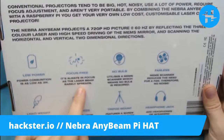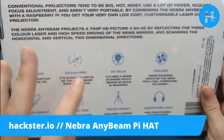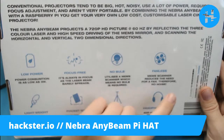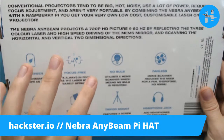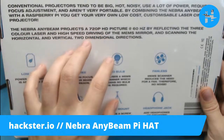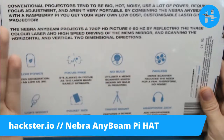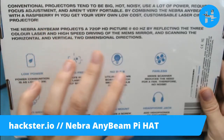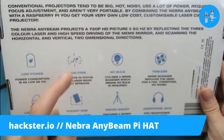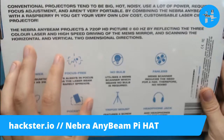Low power, focus-free — because the laser beam is collimated light, it doesn't really get out of focus as you would with something going through a lens. No bulb — it uses a MEM scanner, which means no bulb is required. Basically, you have three lasers in here: a red, a green, and a blue one. There are little mirrors that direct the light around, scanning across the entire screen. The persistence of vision effect means you see the whole screen, even though only a single dot is illuminated at a time. It does this at 60 hertz, imaging the entire screen 60 times per second.